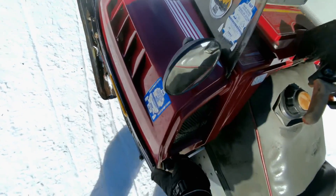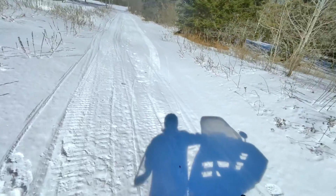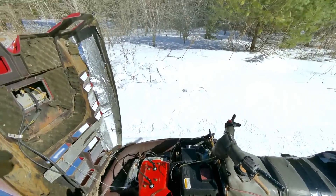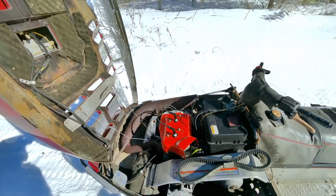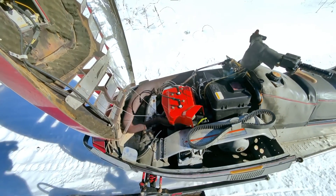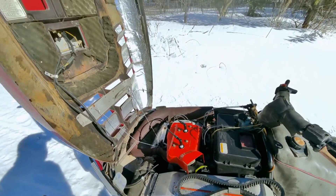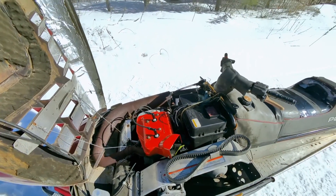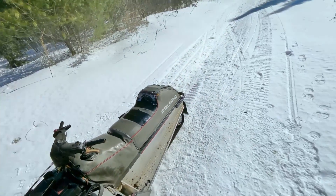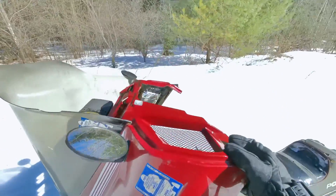So we'll pop the hood here, might as well show that off too. It's not as nice underneath the hood as my sled, but hey it does the job. It used to have a bunch of leaves and crap at the bottom. So essentially to get it going we just replaced the spark plugs, new caps, new wires, new gas lines. One of the carburetors had no choke assembly so we had to replace that. New belt, adjusted the track a little bit, and it fired right up.